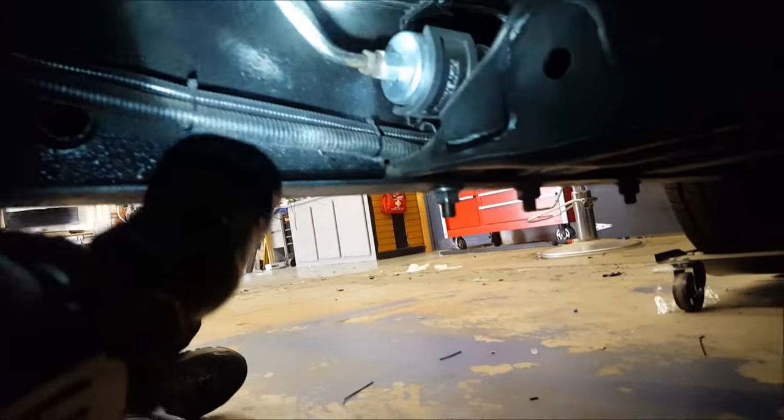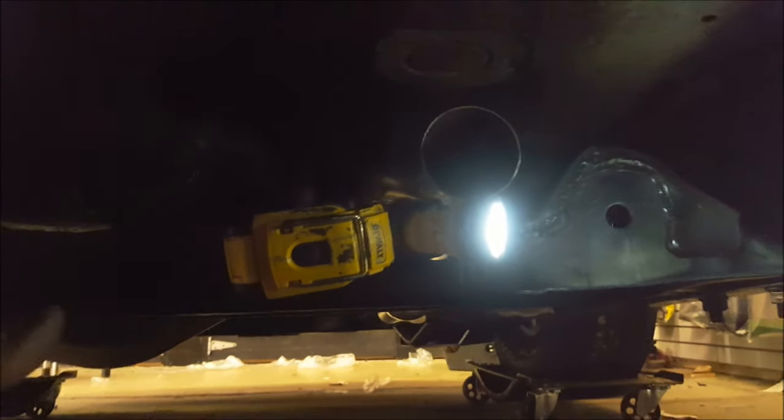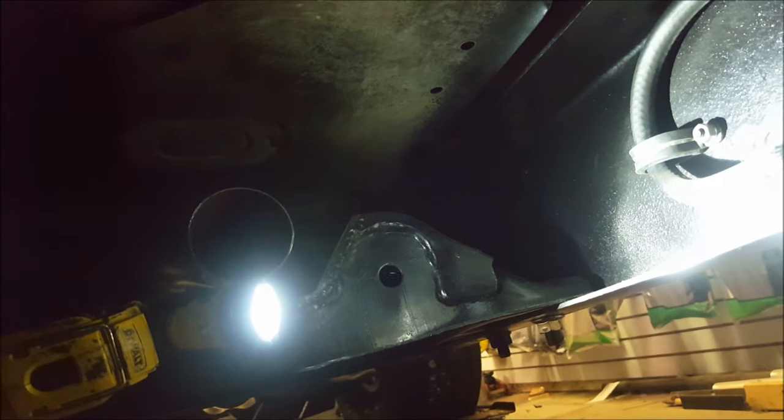Going over the C1500's — or War Machine's — fuel pump, you can see it's all on the frame rail. It's on the right side of the frame rail because if it's on the left side, there's too much stuff going on over there to fit it nicely. We have all these lines and everything, and this was just easier to run and for serviceability. There are some downsides to putting it on this side though — we had to run longer lines and it is going to run closer to the exhaust. One good thing is we have long tubes, and due to smog regulations here, I don't have to run cats on this vehicle, so the exhaust will get significantly cooler. We will build a heat shield as well, just for an extra measure of safety.